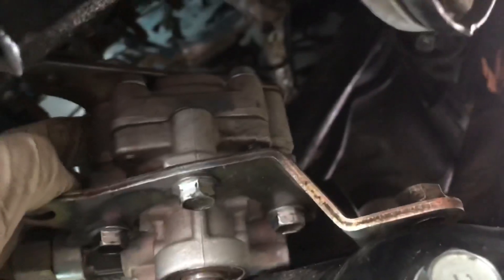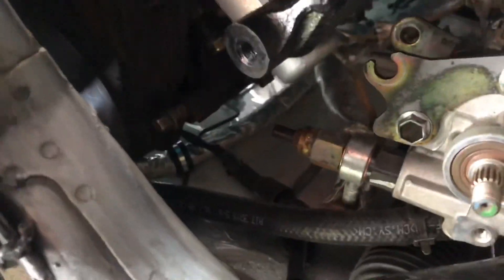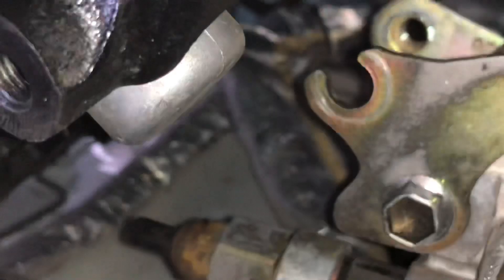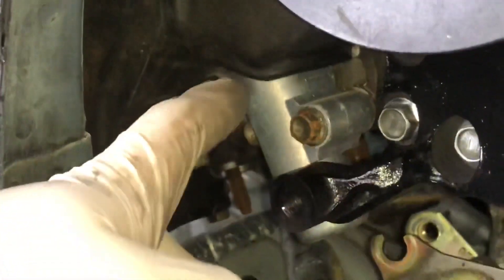You can see I got both brackets installed and they're going to go on this bracket right here. So this is the top bracket for the power steering pump — you're going to see there's already a bolt in here, which is going to catch on to this thread over here. And this one just slips through — kind of gives you a general idea. And then this is going to sit above the tensioner somewhere right here.